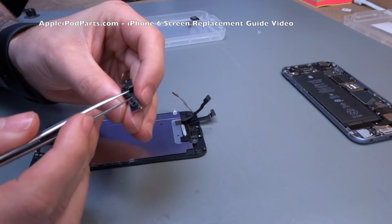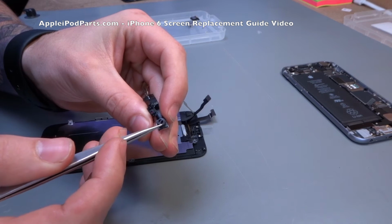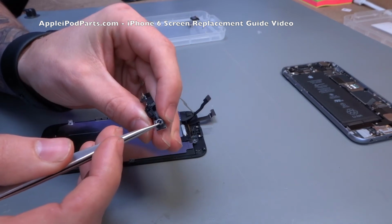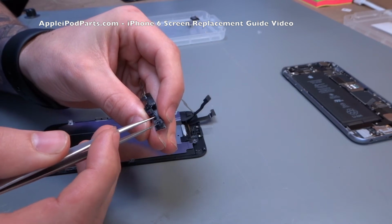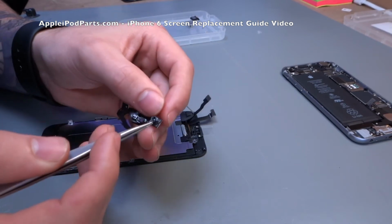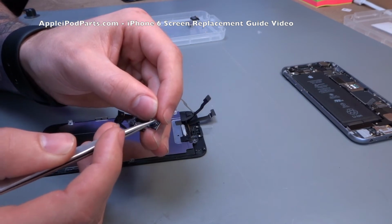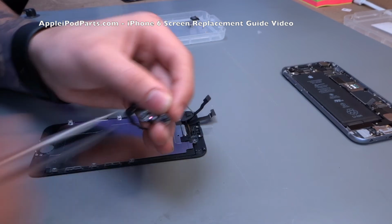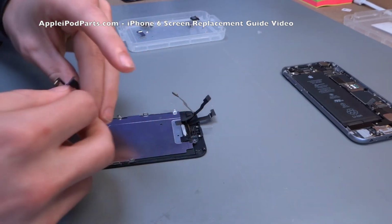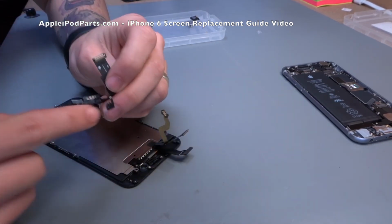But you've got the front camera there, and there's like a foam cover that goes around it, stops the dust from creeping in. It's just misplaced. So he's just refitting that around the outside of the camera, so when it's all together, he hasn't got a piece of black rubber across the FaceTime camera, obscuring the view. It's all in the detail, you see. So the cable we're going to insert, and it should find its home quite easily.